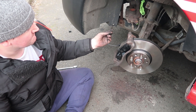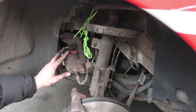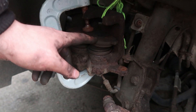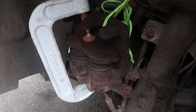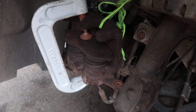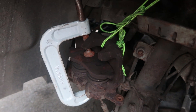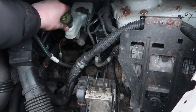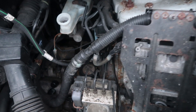I'm going to link it up to the electrical braking system. Last thing to do is connect the brake caliper - depress the piston and you're ready to go. So we've got the clamp on and we've used the old brake pad as a little bit of bedding for the clamp. Before we clamp it down, we're going to go to the bonnet and take the cap off the brake fluid cylinder so it doesn't burst any valves inside from the pressure. There might be a little bit of spillage - that'll be perfectly fine, you can just top it up later.